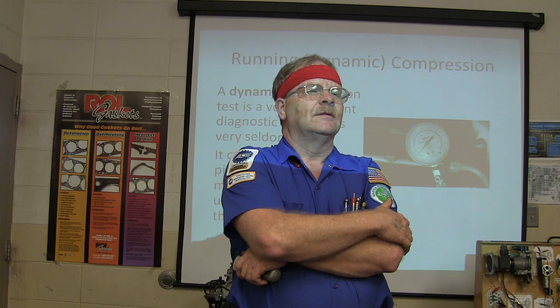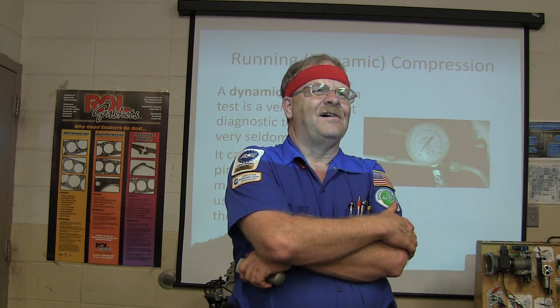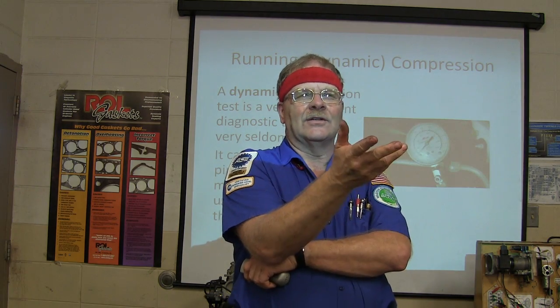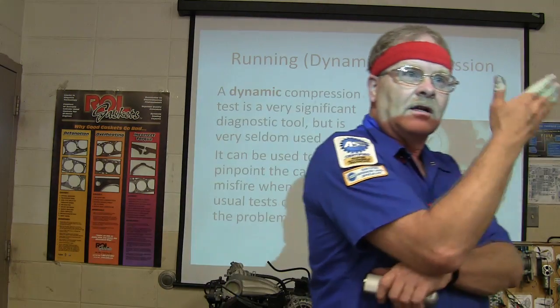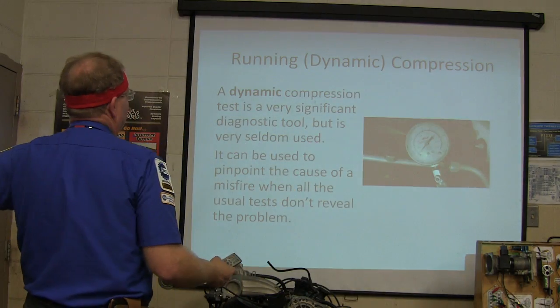Well, if an exhaust valve is sucking the air back out of the exhaust, if it's got a place that it can pull air from, it's not going to have vacuum in that cylinder, right? And every cylinder's vacuum is what gives you that, because the intake valve's open, the exhaust valve's closed, and it's pulling it down. All right, now, just think about that for a minute.